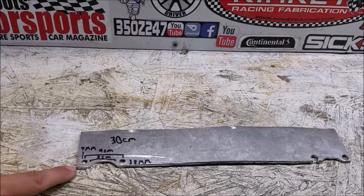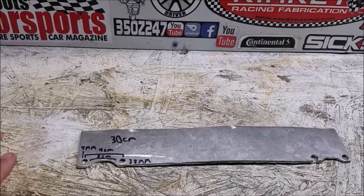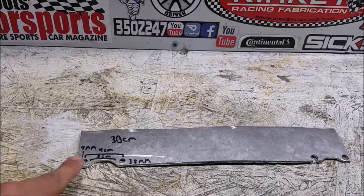If you leave a straight line right here, you're not going to be able to get the tool into place for those two holes. You can make a template first, test fit it, and make sure everything lines up exactly the same on your vehicle. This should also work for E46s or E36s with a mechanical fan.